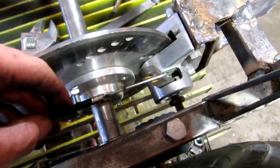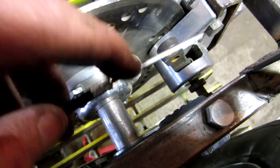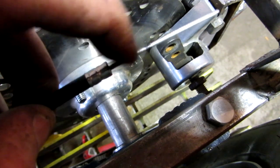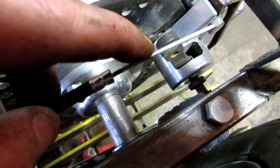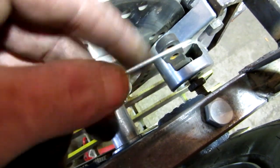Right now I've got my brake setup - caliper - and I need to connect the wire to the lever. Looking at the black marks on the wire, I've already measured the stroke out. When the handle pulls, it looks like it's about three quarters of an inch to an inch. So I need to figure out how I'm going to connect this to that.